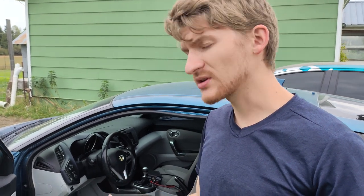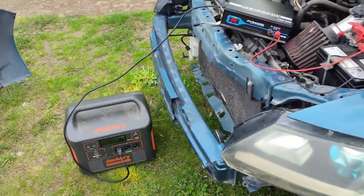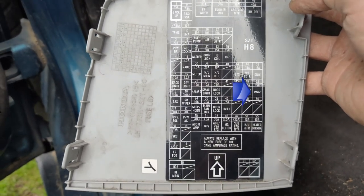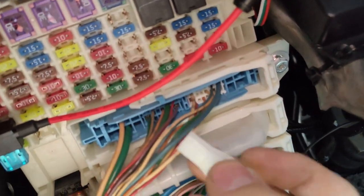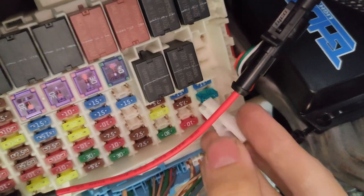So now it's time to answer the all-important question: is it fixed? We're going to start it up, clear some codes, and see what happens. We're going to give our 12-volt battery a little more juice with this charger. But while it's doing that, we've got one more thing to check — our fuses. I saw mention on some forums of fuses being blown when these fans go out, so it's always worthwhile to double check. We're lucky enough that this car still has the factory fuse puller. It looks like ours is indeed popped. Okay — battery topped off, fuse replaced, and new fan installed. Let's see what happens.